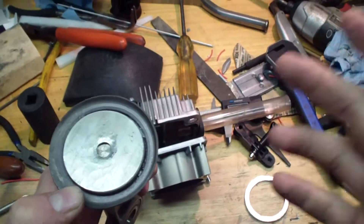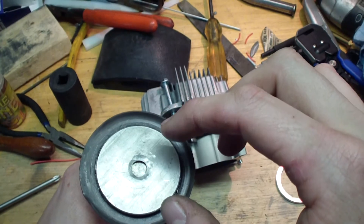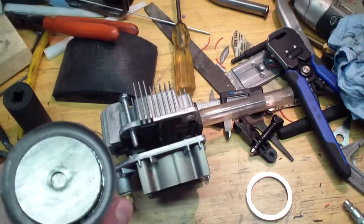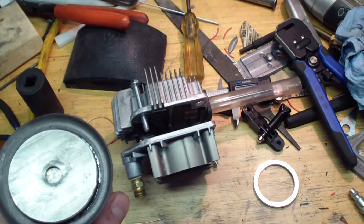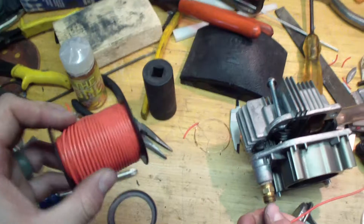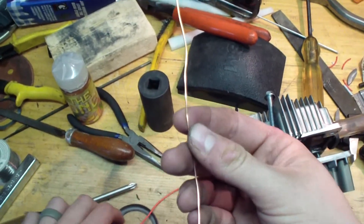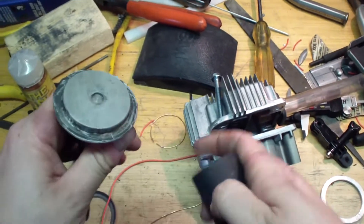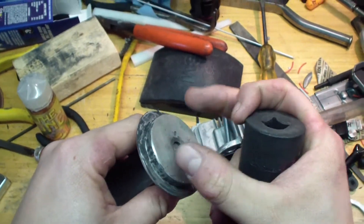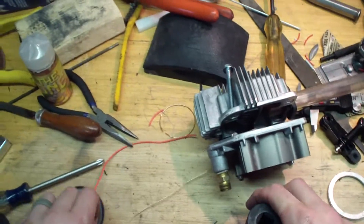This seal needs to be re-centered somehow. I read online that another guy put wire in here and glued it to center the seal. I took measurements and found there's a one-millimeter gap all the way around, and the closest wire gauge to one millimeter is 18 gauge, which is about 1.024 millimeters — perfect. I have a spool of solid 18-gauge wire. You want solid wire for this. Cut it to a length that will go all the way around, then take a socket that's a little bit smaller than the diameter so when you coil it the spring action makes it want to expand back out.